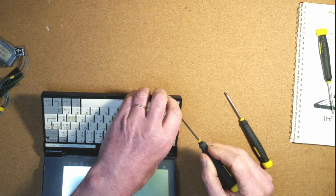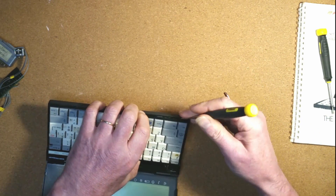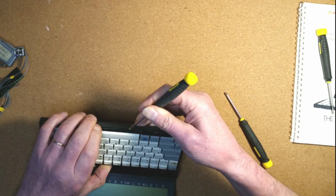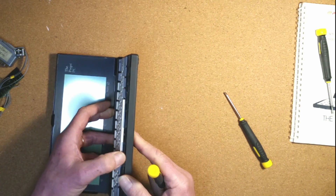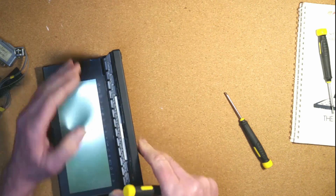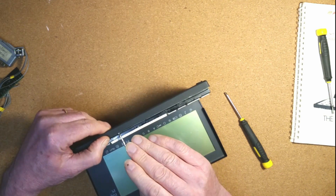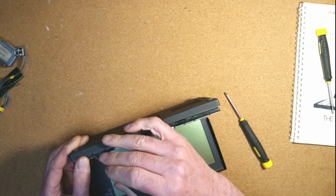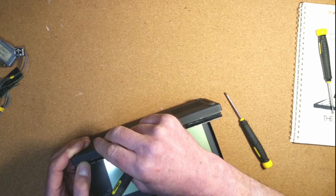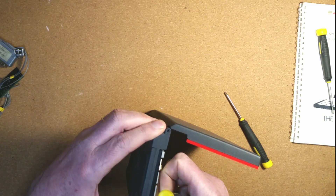If you Google the Pocket there's very little usable or accurate information. You'll likely encounter posts suggesting that getting to the motherboard is a simple matter of locating and undoing the screws hidden under the rubber feet, one at each corner. Not so. In fact the computer is sonically welded, and to open it you must be prepared to break the welds. It's a tricky job with plenty of potential for catastrophe. However, if your Pocket is exhibiting the booting-to-black-lines fault, there may be nothing else for it.